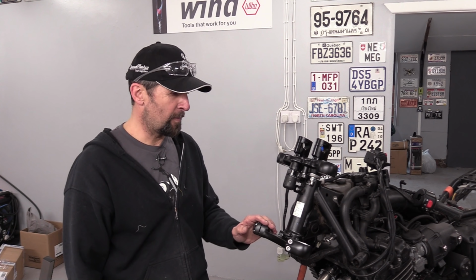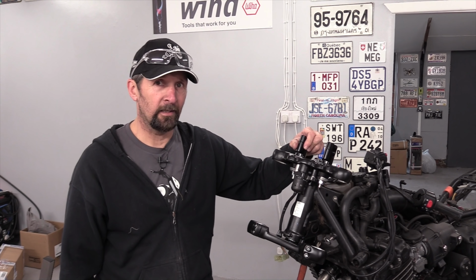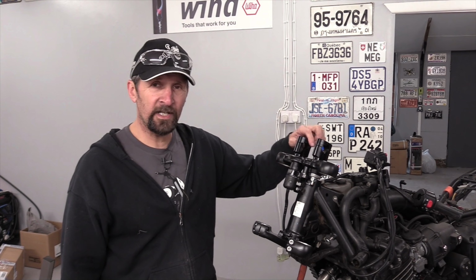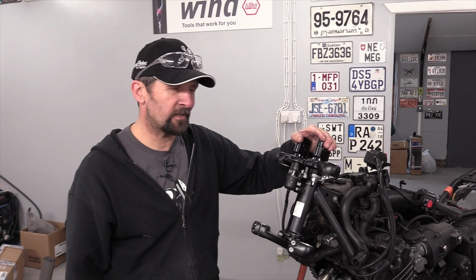For today, we've got new paint, new bearings, and new risers. Now, the risers are not on there because they're black or because they're tech. They're on there because they're 28 mil. I'm gonna lose the 7/8 factory cowhorn bars. I'm gonna put a nice fat 28 mil fat bar conversion in it. That's gonna look really in keeping with the rest of the bike, but that's all in the future.